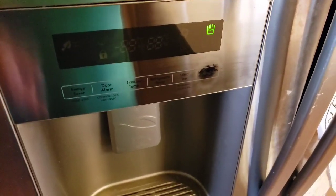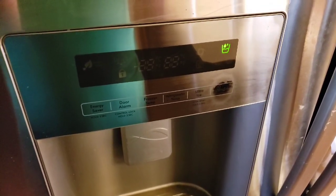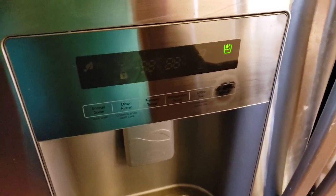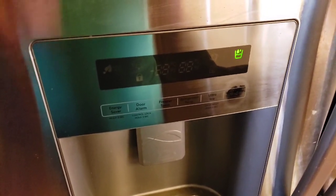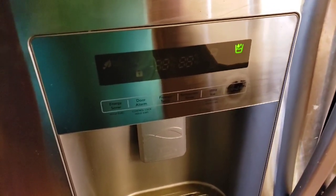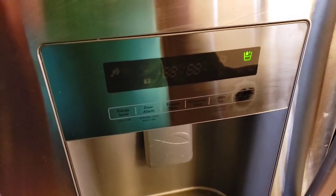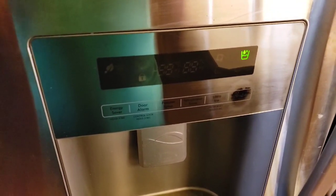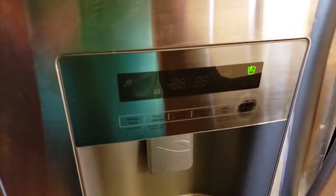And if my heating coil down there is not working, which you saw in the video, you saw that those connections went into one connector, you'd actually have to buy the heating coil separate. I think I saw that online for about 50 bucks. And then there actually is a plug in the back of that freezer for you to put in the heating coil, and it looks pretty easy to replace. So you could actually pull out the heating coil, then you could pull out the thermostat and the other sensor that I bought, and you could actually make all of that connection work, even in this model, even though it's not wired right now.